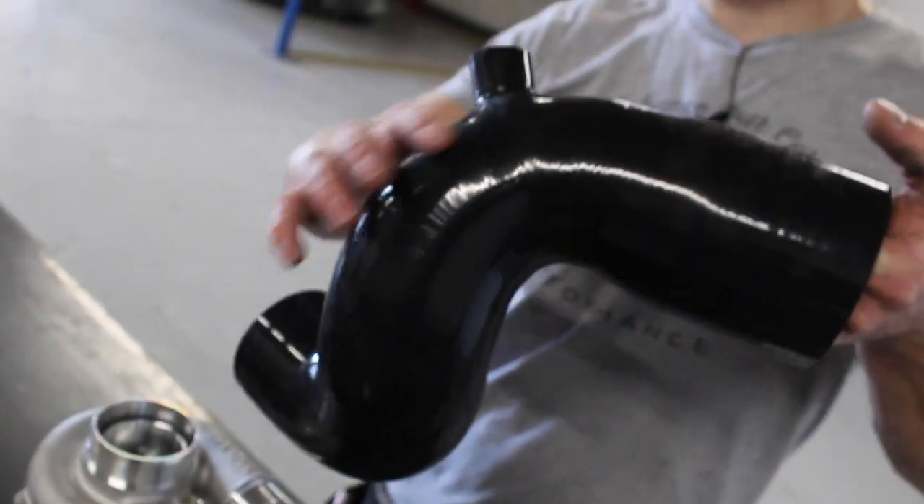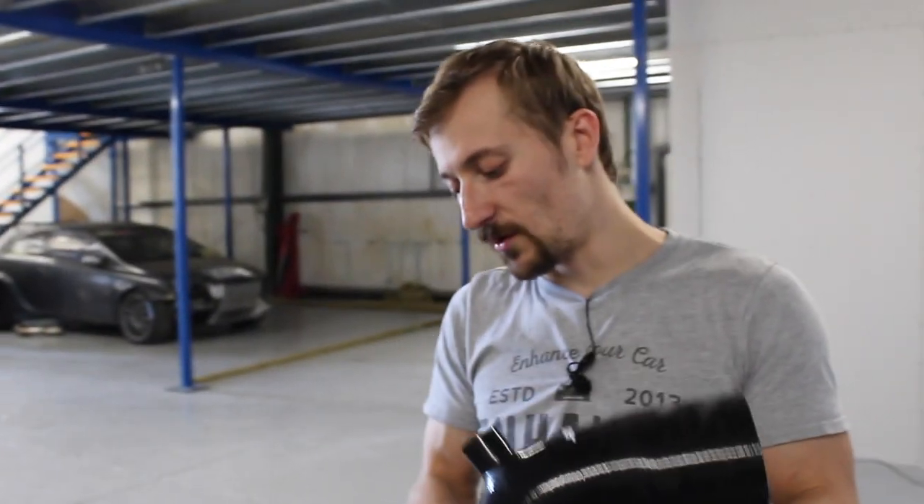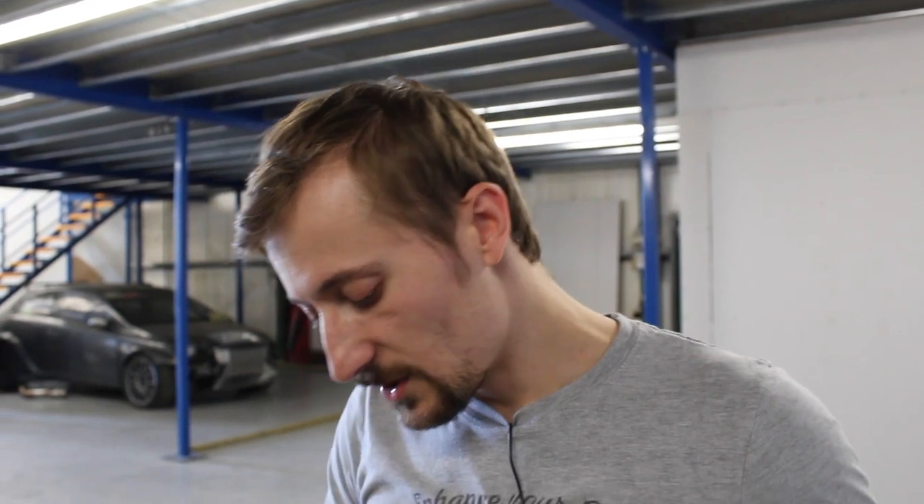It's a kind of twisted S-bend, and the whole idea is to keep the airflow nice and smooth as it enters the turbo. We don't want any restrictions — it all comes down to efficiency. The engine is just an air pump, so we want it to pump the right amount of air in and out as efficiently as possible. We produced our own tooling in-house and JS Performance make the hose on that tooling for a perfect fit. A solid pipe would have been so difficult to actually fit onto the car — you'd more or less have had to install the intake pipe before bolting the manifold on, making it very hard to service.